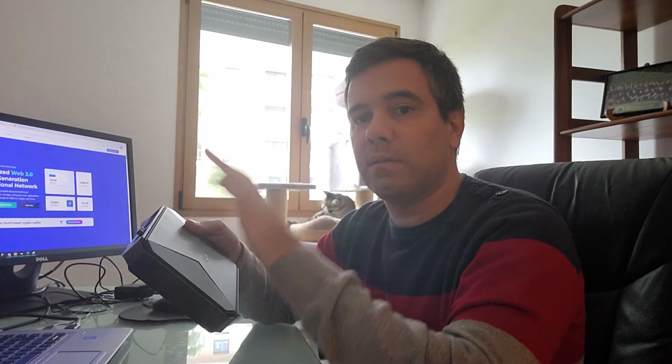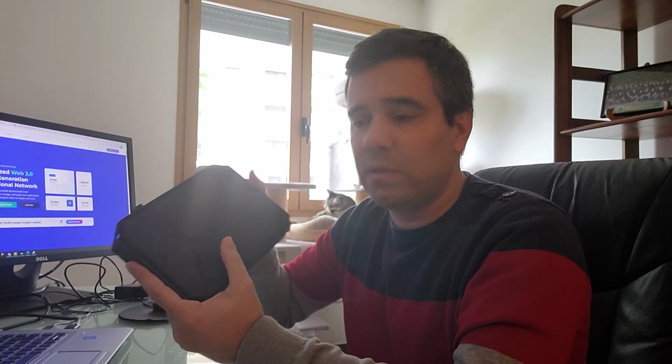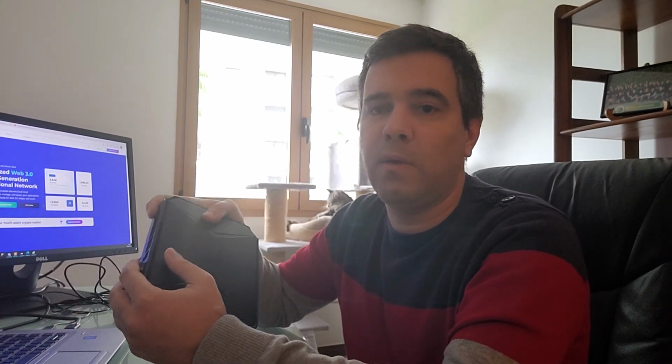So this is the part that I want to explain to you: how cheap it is, and you can run this from home. And also the most important part that I'm already going to tell you is the low power consumption. I got between 2 watts and 5 watts on this Chuwi. When it was at full load, it went to 12 watts, but most of the time it was between 2 and 5 watts. That is lower or equal to what I got with the Raspberry Pi 4B. So it's impressive, and it's a normal computer that can be used later as a normal computer if you don't plan to use a FluxNode on it anymore.